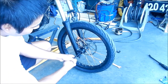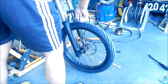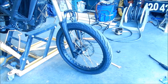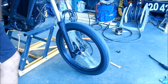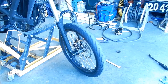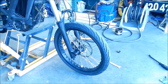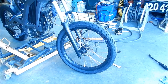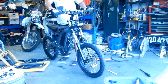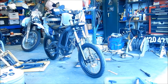That should be good. Let's see if the wheel spins properly. It looks like the bike has sagged since the last time I put it on the stand. Looks like it spins just fine and brakes just fine. So the next thing to do is lower the bike. I'm going to check for play in the headset — just give it some front brake, push it forward and backward. And there is some play — I can feel it.